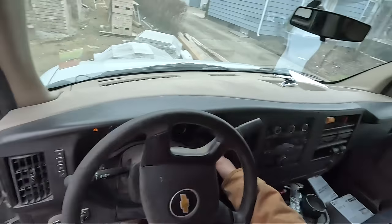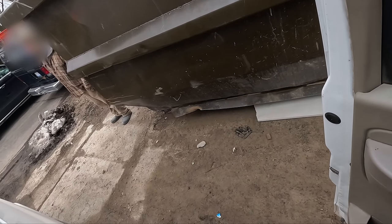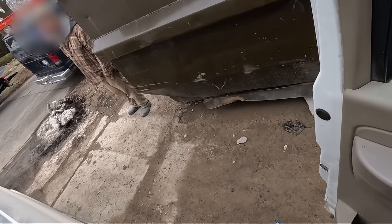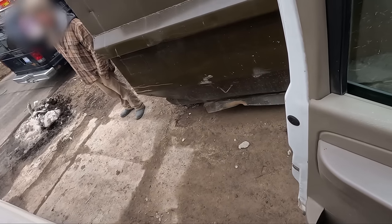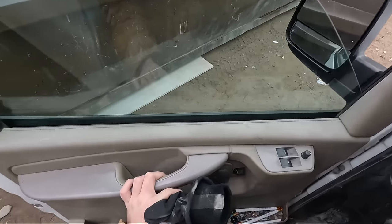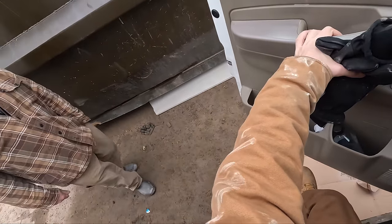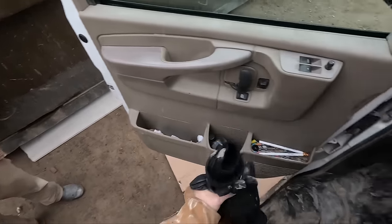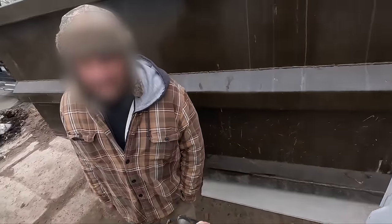Let me see if I can get it in reverse. Just going a little bit to see if it goes in reverse and drive. We got reverse! You just got to be real light with it. Drive — there you go. So it's just your linkage — it's a super easy fix. They just need to get a new bushing for it because the little rubber plastic bushing breaks.